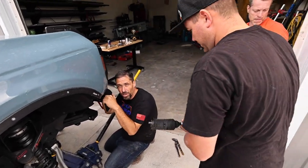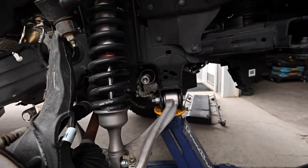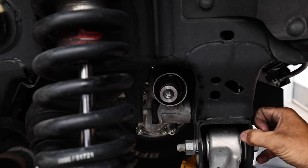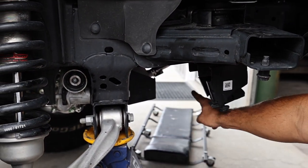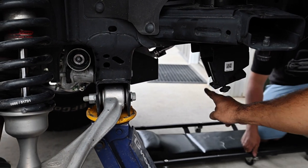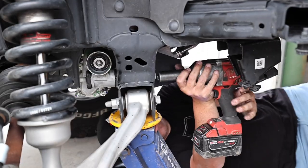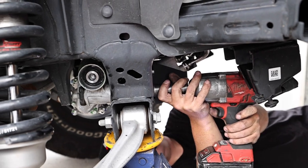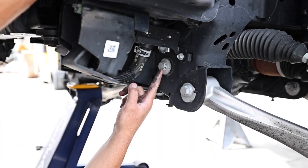Now with the tie rod off, we're going to go ahead and turn the steering wheel back the other direction and proceed to lower the steering rack by removing this bolt. There's one bolt on this side and then there's a bolt on the other side — this one we remove, the other one we just loosen. Take your impact with a 21 millimeter. With that side loosened, the whole rack is now pointing downward where it's easy to get to the parts. That's where you're going to need the T30 Torx.